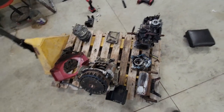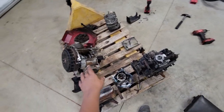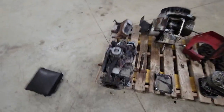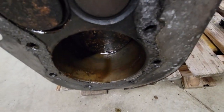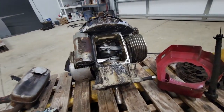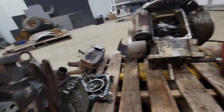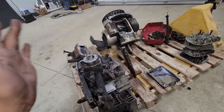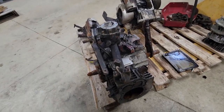What I'm actually going to do is - because that block has barely any rust in the cylinders, only a little bit on one side, and this one is really rusted on both sides and just really bad - since I have that engine and I need parts from it anyway, I'm going to take basically everything from that one and put it on here. I'll come back when I get some progress on the teardown.